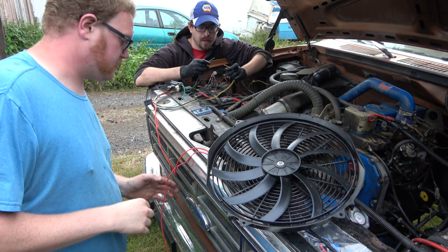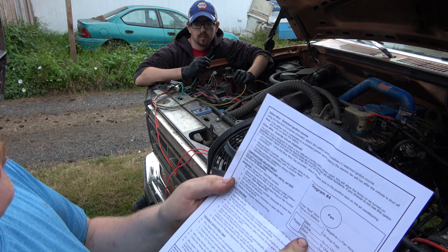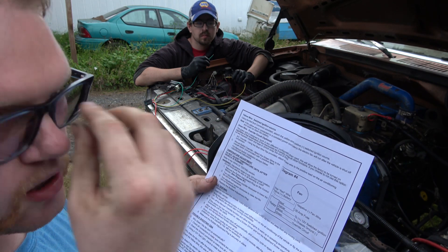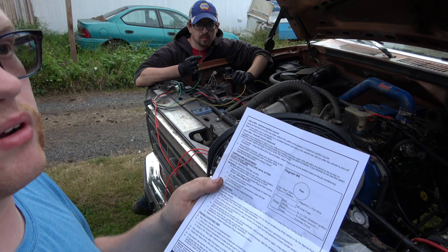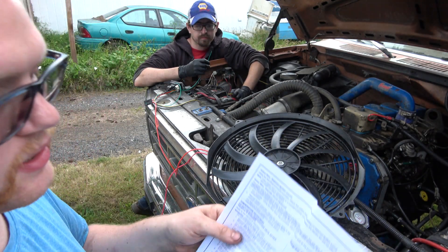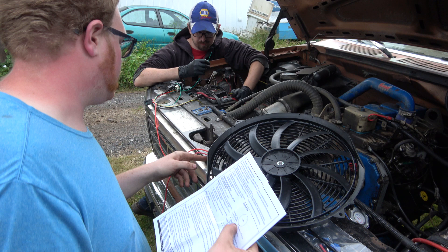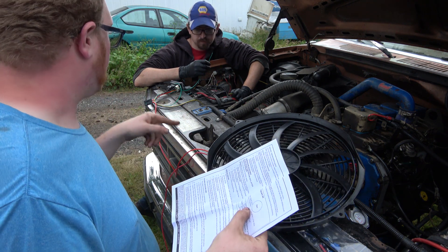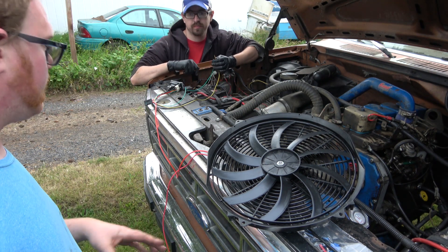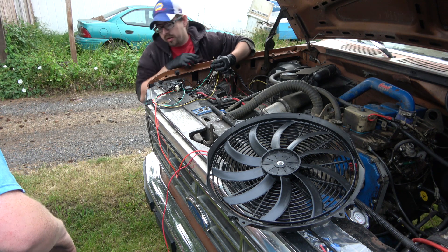I had to look at the diagram and kind of study it. So here's how they're working this: you have your black which goes to ground. And then you have your yellow, which is your switched ignition, which arms the controller. Green is your manual override for AC, or if you just have it on a switch, which just turns it right on. The big red wire actually goes to the negative fan wire connection. And then on the red or blue connection of the fan - which is the power - that goes out to the battery. So after I hook this test wire up, then he's going to hook the green and yellow to turn the whole thing on, and then we'll see if it works.